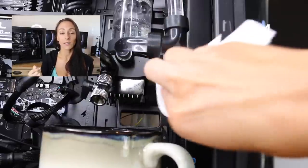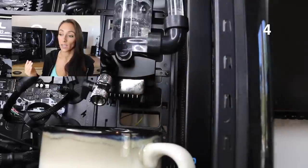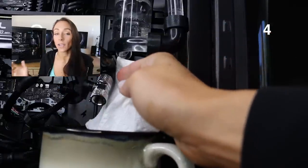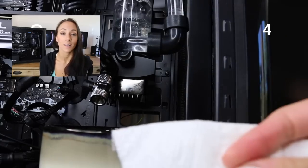I turned the pump off and tightened the fittings because suddenly they had some slack and I could tighten them. I don't know if it was the pressure from the pump or if I just didn't tighten them enough the first time, but after doing that a couple of times I got rid of all of my leaks by simply tightening my fittings a little tighter.